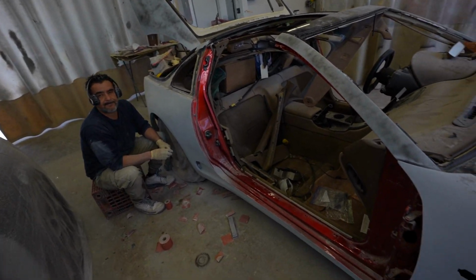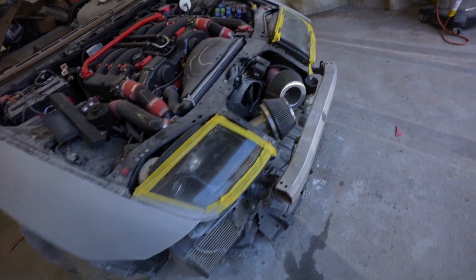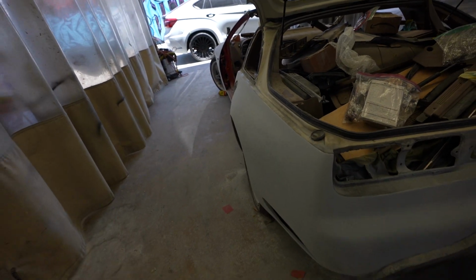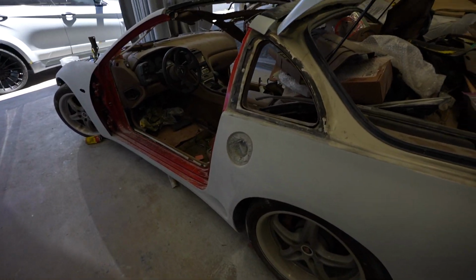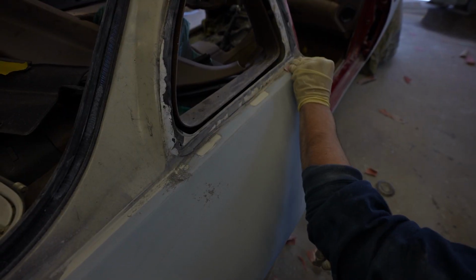Better finish, yeah. So we're gonna continue working on this, getting it all blocked out, going through all the steps of that style sandpaper to finish off to a smoother grit, and then obviously do a nice wet sand so it can be ready for Richard to lay that candy paint on there. So we'll continue blocking on it and getting this thing ready.